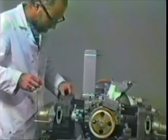Screw it on. Put the less nice one on the lower stud. Sometimes this thing will plop off, but really not too hard to put back on again. Sometimes the studs are kind of long and hit against the heater box, but you can get them on by moving the heater box towards the front, towards the flywheel a bit. Okay, you got that on.